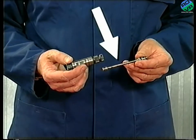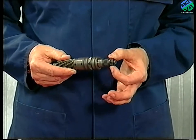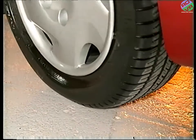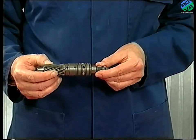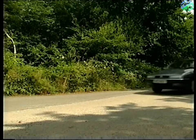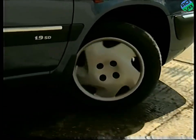The valve is fitted with a torsion bar. One end is secured in the pinion, and the other end is held in the rotor, which is directly connected to the steering column. The torsion bar determines the level of power resistance in proportion to the resistance of the tyres on the ground. When the steering wheel is turned, the bar twists, resulting in an offset between the rotor and the pinion. At low speed, the resistance is high, and in turn the larger offset allows more assistance. But at higher speeds, or when driving over a slippery surface, the resistance is comparatively low, resulting in less offset and in turn, less assistance.